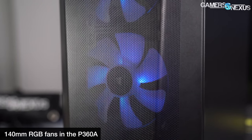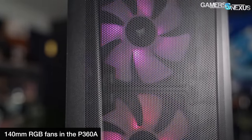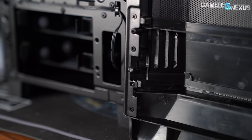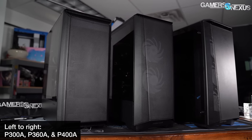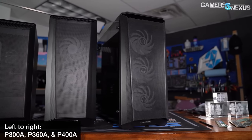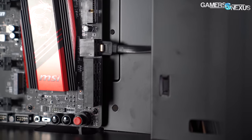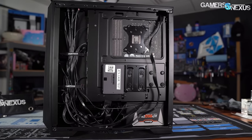The top fan mounts are evenly ventilated across their full 140mm width, but the front fan mounts were built with 120mm stock fans in mind — 140mm RGB fans will look odd when installed. The P360A contains the same plastic shield inside the front panel to prevent air from recirculating through the PSU shroud or the bottom, but additional small vents in the sides help keep heat from building up in the hard drive cage. The bottom of the front panel has been redesigned to look more like the P400A and P500A, with a silver Phanteks logo and a plastic frame merging into the case legs.